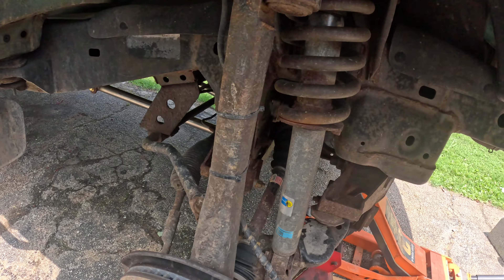I got the lower ball joint out — forgot to record it. People may run into trouble getting the lower part out; I was just banging with a hammer right there and eventually it'll just pop out. Same thing goes for the tie rod — I believe it's called peening it out. I got everything painted, needs a couple touch-ups, but I'm getting ready to install the strut now that the ball joint's out so I can move things away from the mounting spot to make running the bolt in a little easier.